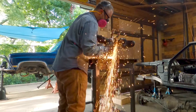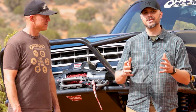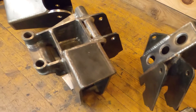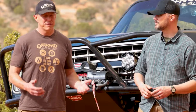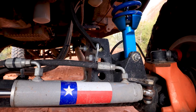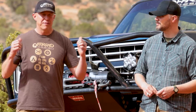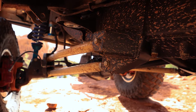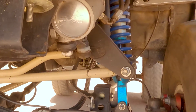At this point you will have also cut off all the vestigial parts of your old leaf suspension — shock mounts and leaf pads — so it's a clean tube. Now get out the brackets you're going to use to attach the links to the axle and to the frame. This is really the core of the system: five brackets that pretty much right out of the box give you very good suspension geometry. You're going to have axle brackets — just one pair — that do everything in one shot: coilover mount, link mounts, limit strap mounts, the bump stop pad. Then you've got the frame-side brackets for the links and the panhard bar mount.